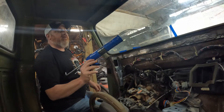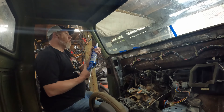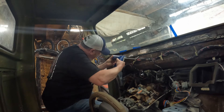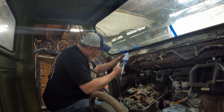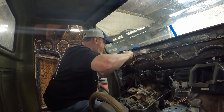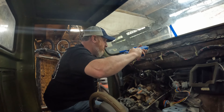The stuff I got off of Amazon, I don't know if it's any good. It's just seam sealer, but it says you got to use it the same day you open it. We'll do the best we can with it, honestly. And then we're going to work it in with a finger — kind of like how we would just do caulk. We'll just run it in and then hit it with the finger.